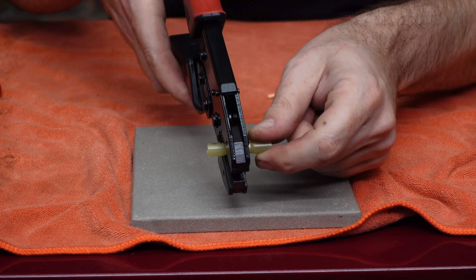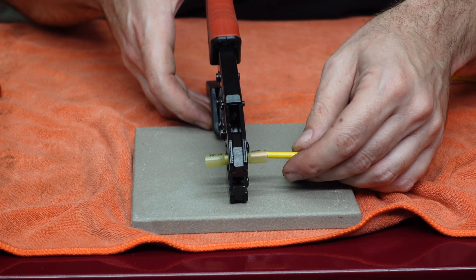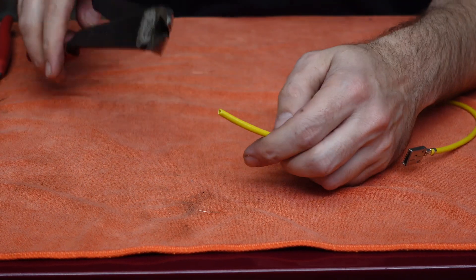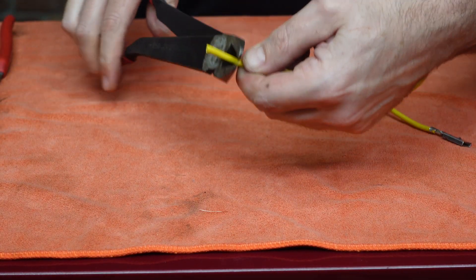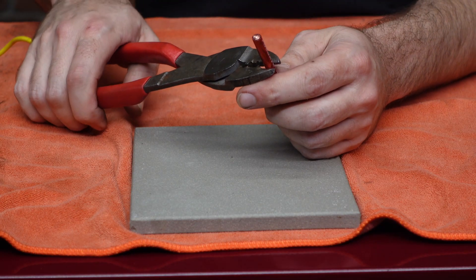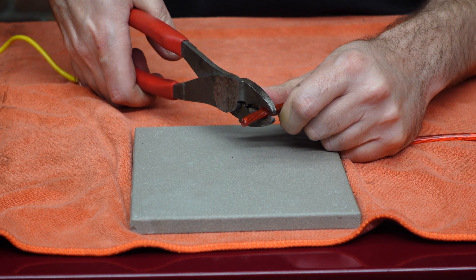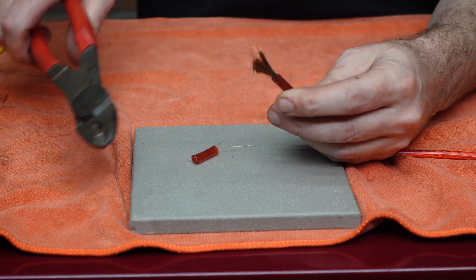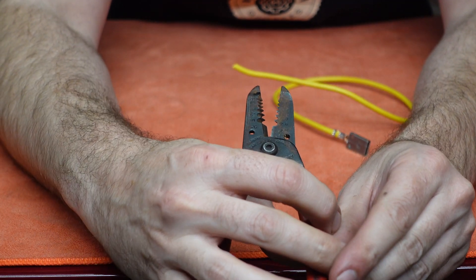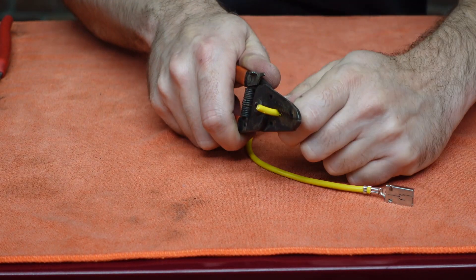Here's the solution — this is the technique that was taught to me by Audi and is by far the most superior way of joining a wire. But first, let's go into how to properly prepare a wire for a crimp. The first step towards making a proper crimp is stripping the wire. You need to strip away the correct amount of insulation — if you take off too much, the conductor will be exposed too far outside the connector and you risk a short. You need to use the proper tool to do the stripping; any type of diagonal cutter is not recommended because these tools have a tendency of cutting into the strands, which reduces the current carrying capacity of the wire. The proper tool to use are pliers made for stripping specific gauges of wire — you can see the markings on these, and if you insert the correct gauge wire into the correct hole, the cutting opening is sized properly and you won't cut into any of the strands.